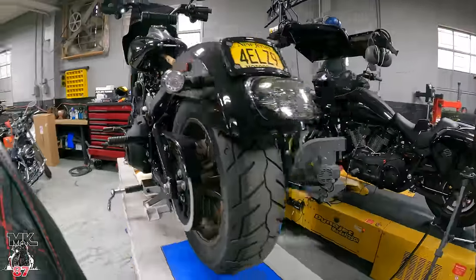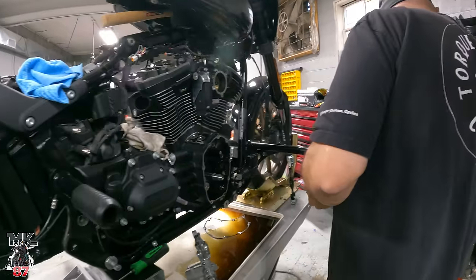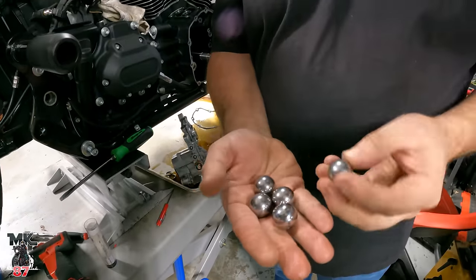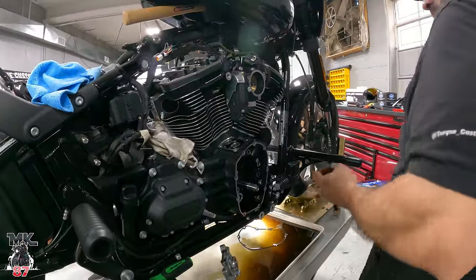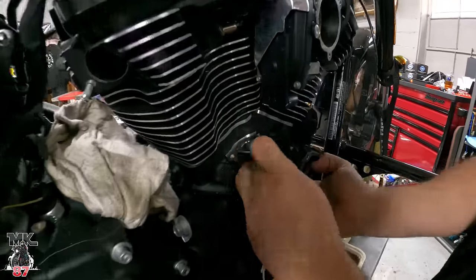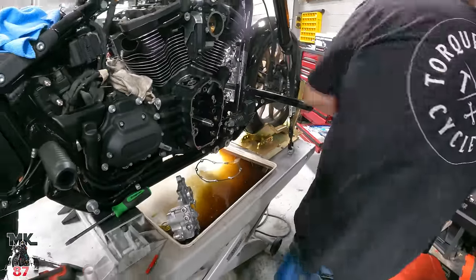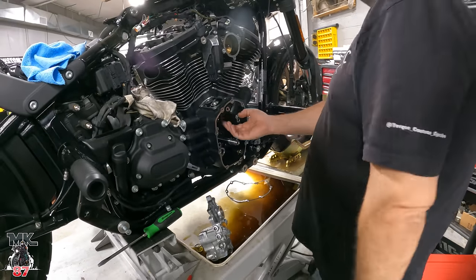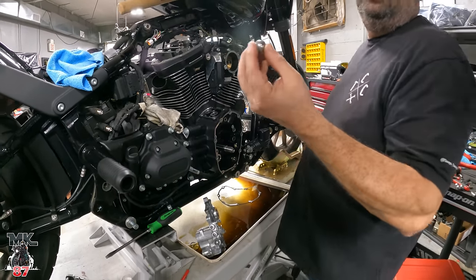So Fueling makes a few different size lifters. In the kit, they give you four or five different size lifter bore tools. They all have numbers on them, like 8430. It's for measuring your lifter bore. If the 8430 makes it through, but a larger one won't go through, then you know that you've got to order larger lifters.